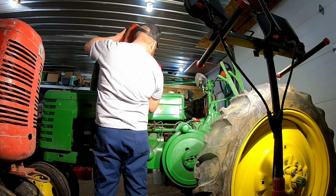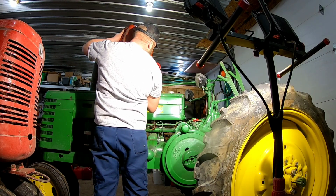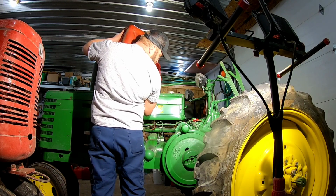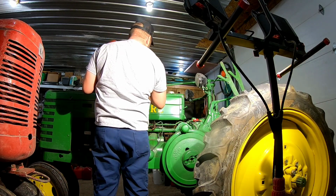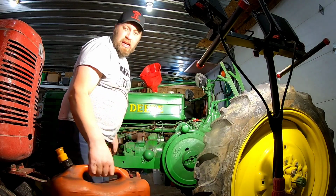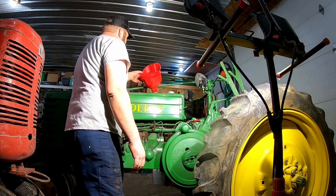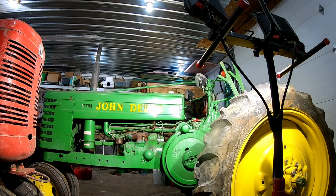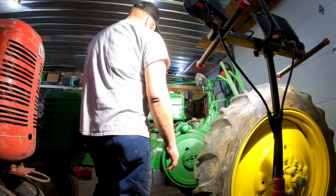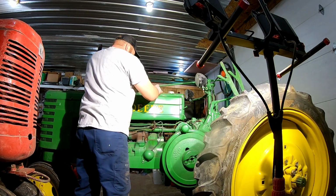And this is 91 non-ox. $4 a gallon, but whatever. I'm gonna put about an 80 to 1 two-stroke oil in it just to give it a little cushion on the valves. Kerosene had a little bit more cushion on them. If this doesn't have hardened seats in it, you take the risk of pounding out seats.